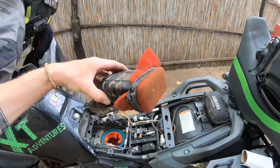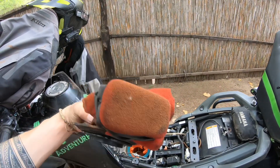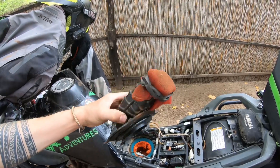Something else I have to check from time to time is the air filter. As another solution I put on the snorkel — I put another layer of uni-filter, cut it into pieces and put it over the snorkel.